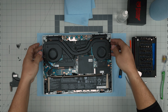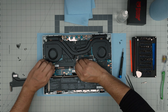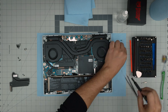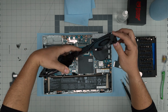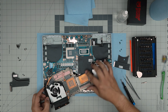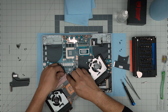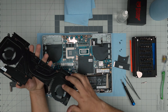Once the screws are loosened, always hold the heatsink from the end closest to the CPU and lift slightly to break the seal. Do the same on the GPU side. Remove the SSD heat plate too, as it may be holding the heatsink. You'll notice the thermal pads were squished and the factory thermal paste is quite dry. The thermal pad may have shifted off the power regulators — reposition it correctly. Take the heatsink outside and clean the fan with a toothbrush and compressed air.